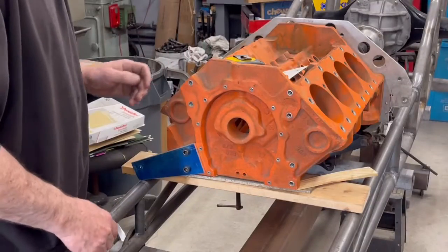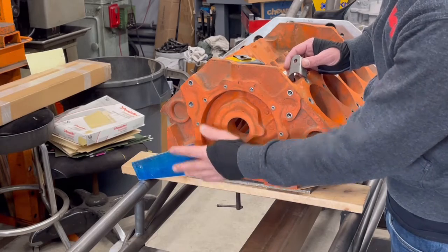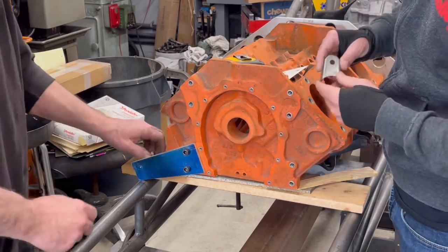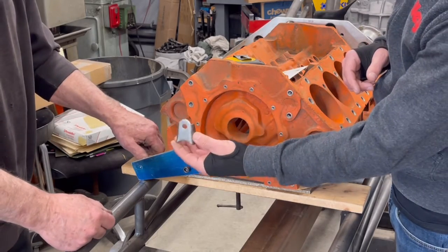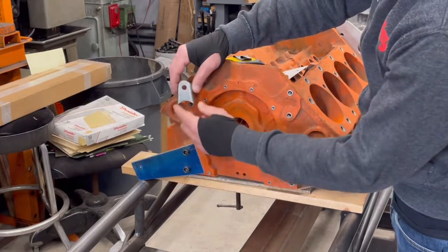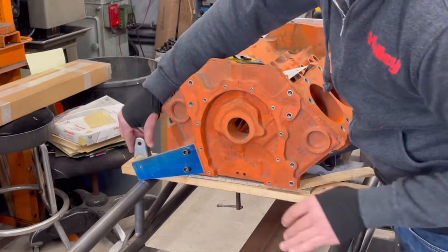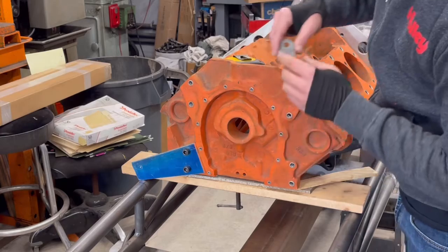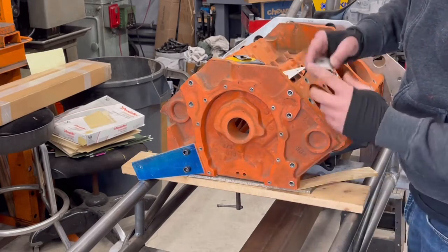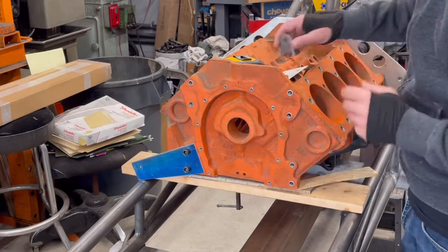Jimmy had already drilled these holes here that go to the front of the engine. This is actually all in place, mocked up where it needs to be. He's got a shim in place and he's measured to make sure. So now what we're going to do is figure out where these chassis tabs go. We're going to make the other one, and then we're going to make sure where our chassis tabs are going to go — this is going to correlate to where these are going to sit in the back. We've got this one in place; we're going to get that one in place, and then we're going to determine the actual placement of these tabs so we can get these on and drilled.